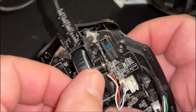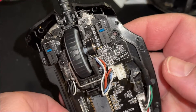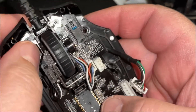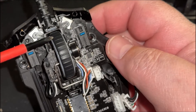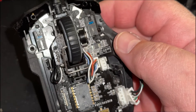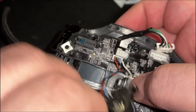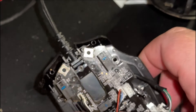With those four screws out I can take off the main board, but the scroll wheel is still a problem. You'll see where the scroll wheel is attached — at the top and bottom there's one main plug going into the main board, you can just undo that. At the bottom side there's a little tab, and you don't have to push with a lot of force — just move it out of the way a little bit and the mouse wheel will pop out just like that.